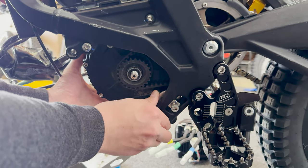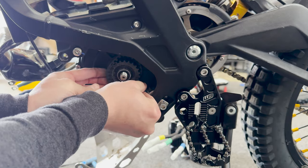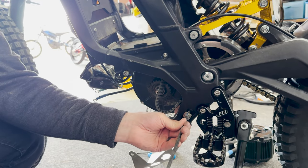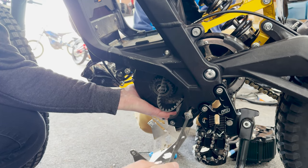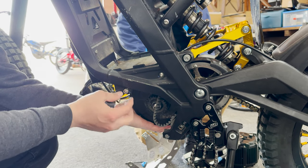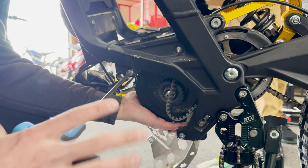Now we're going to fold the motor down — that allows us to literally pivot it. We pivoted the motor up so we can get the belt off. Work it just a little bit, and the belt will come off; tuck it out of the way. Then remove the bottom two bolts first. You're going to want a little support on the motor — it helps to have a buddy to do this. Remove the bottom bolts first, then take the top two off and the motor will literally just fall out. You've got to be holding it because it's like 20 pounds.